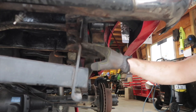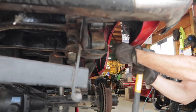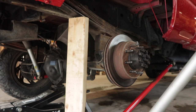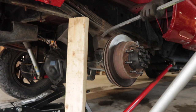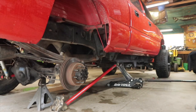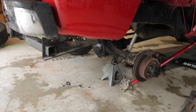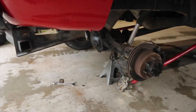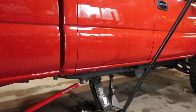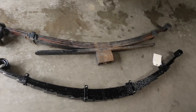Just one little note — not everybody has the same exact hitch. What I ended up doing is just removing both bolts on this thing so it'll hang a little bit, that way I can get clearance to extract the bolt out and get it away from the leaf spring. Now, one thing to mention before you even attempt this job: make sure you have jacks. Jack stands are so important — I have a jack stand and a four-ton jack, so pretty heavy duty. You don't want to get hurt during this job.